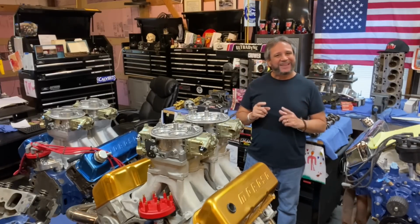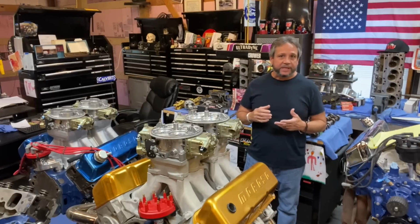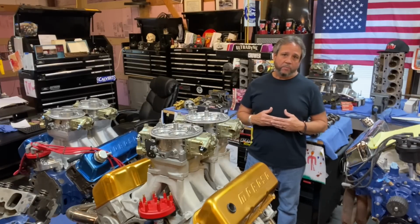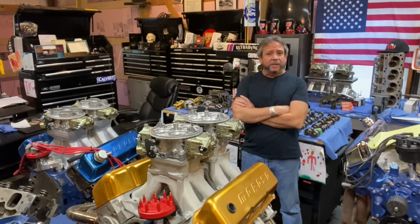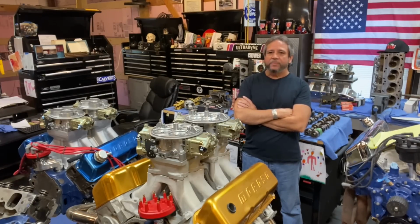Now the lobe lift on that is 550 thousandths. On the DragBoss 427, we're going to use a T&D 1.75 rocker arm ratio. Multiply that, and it's coming up to like 963 lift. With those kind of specs, you need to have control over that. That's going to be a whole different topic that we're going to get into, but I've just touched base on it.